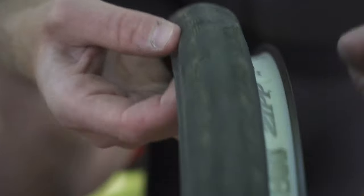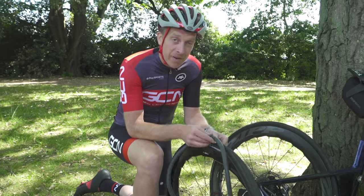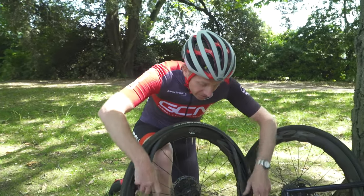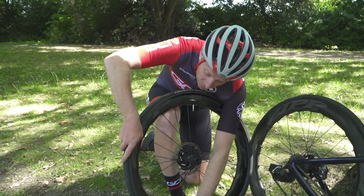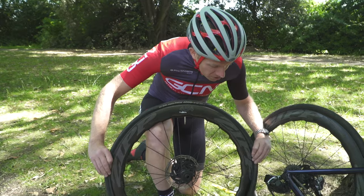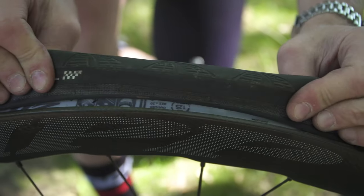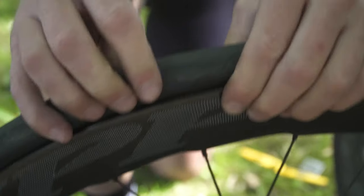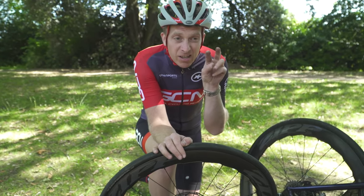This one is all okay, so we're ready to fit the tube again. In goes the valve — I always do valve first, though some people prefer to finish at the valve. It's simply a case of putting the inner tube inside the tyre. What's important is that it doesn't become twisted or out of shape, which is why putting those initial few pumps of air in really helps. Once it's on, check around the inside between the bead of the tyre and the inside wall of the rim to make sure none of the inner tube is poking out, because that can cause a pinch puncture when you inflate.